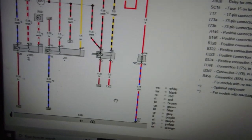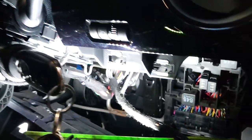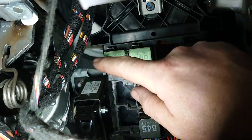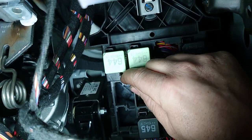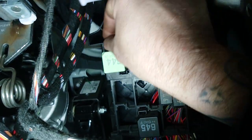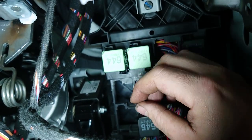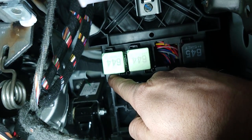I've done the donkey work for you. So I've undone some screws up the side and pulled this panel down out of the way to get to our relays behind here. The relay we're dealing with is this one up here — this is the one I want to get out. It looks like I've got a couple of little tabs. Push tab down, tab up, and it should come out. I'm going to take that out and quickly check this relay, then we'll see what supplies we've got behind here.